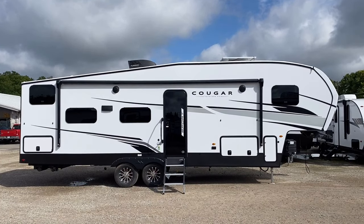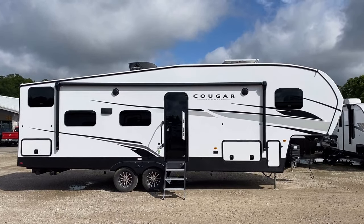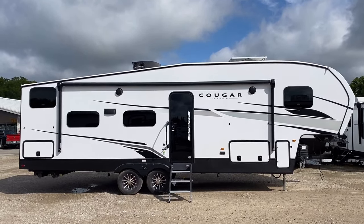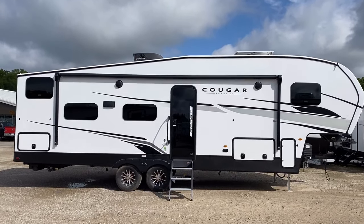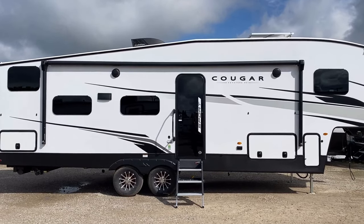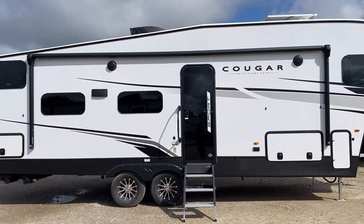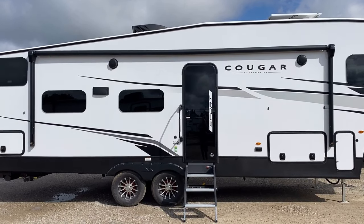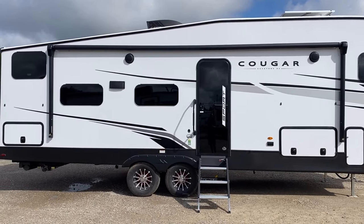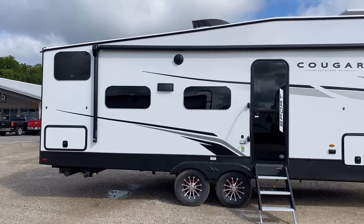Those have all gotten better. Every single panel that Keystone's using this year is 10% bigger than it was last year. But this is their smallest, most basic package, the 220-watt system. Last year, it only came with a 15-amp controller. It was a nice Victron controller, but it was small. You couldn't expand much on it. This year, it's a 30-amp controller standard from the factory, so if you do want to bulk up on this a little bit without having to go massive in debt doing it, that's something that you can accomplish here.